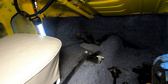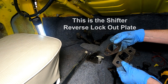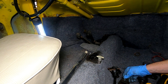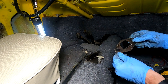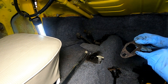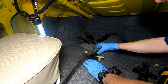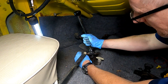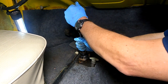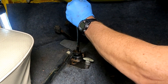The problem we were having is getting it to shift into gear. So we took the old shifter out, and as you can see, it's significantly bigger than the factory one — the stock one that came with it. I don't necessarily know if that's a problem; I don't think it is. It should still work fine, but I'm going to go ahead and put this plate in, which is what originally came with the vehicle. This is a reverse shift lockout detent, and what you're going to do is essentially center it here, then drop the shifter in. You want to make sure that spring is centered a little bit so this plate is centered on here, then we're going to put the bolts in.